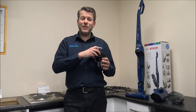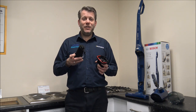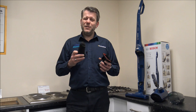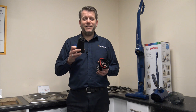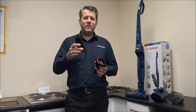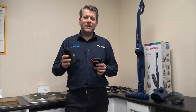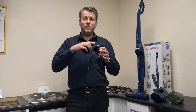Unfortunately that won't be covered under the manufacturer's warranty, which on these models is actually two years — so that's pretty good. What I'd normally recommend with any vacuum, cordless or not, is to buy a spare filter when you're buying the vacuum. The main advantage is if you wash this one and it's on the side drying — which can take around 24, possibly 48 hours to dry completely — then you're not without the vacuum. You can pop the other one in straight away.